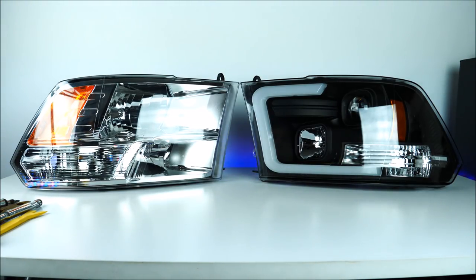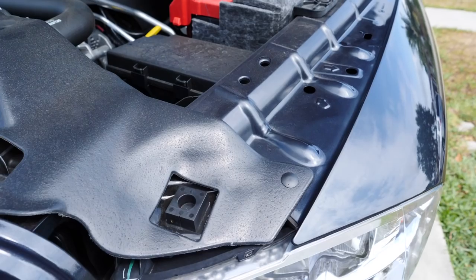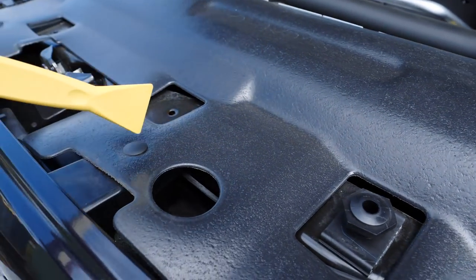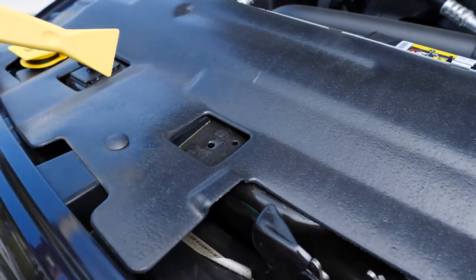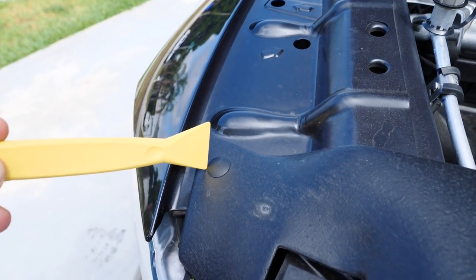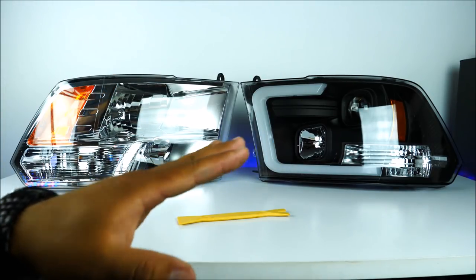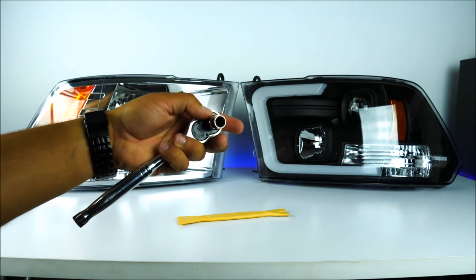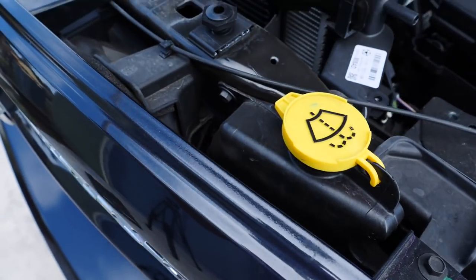The tutorial is really easy. First of all, you must pop the hood open. Once you do so, you're going to see a cover with approximately five or six clips on the very top. You need something like this pry opening tool so you can release all those little clips. Once they come off, the whole entire cover is going to come right off. Put it aside.